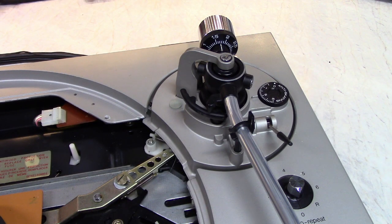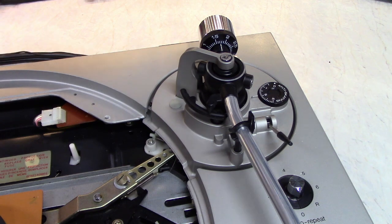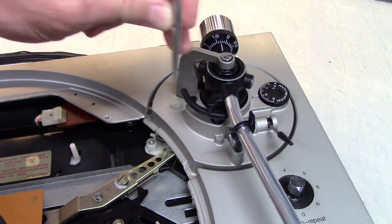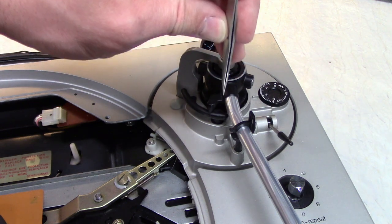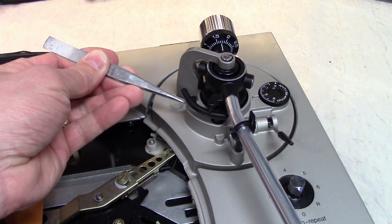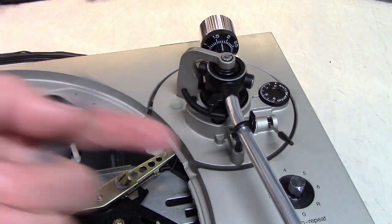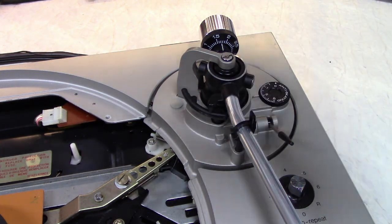To replace the fluid in the Q dampener of this turntable it's quite a bit of work. In some turntables they let you lift the cylinder up from the top to re-lubricate it, but they made that impossible on this turntable. The screw that attaches the arm that lifts the tone arm has a hex head embedded in a hex hole, so there's no way to turn the screw without turning the whole arm, and the arm is held captive by a pin. The only way to do this is to take it all apart and remove the whole tone arm assembly and take it apart from the bottom side.